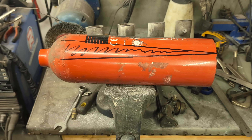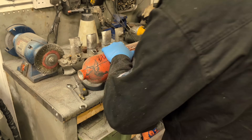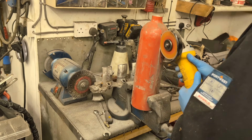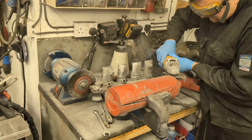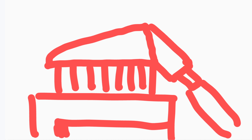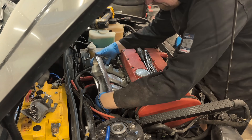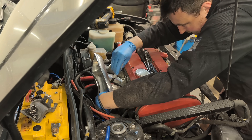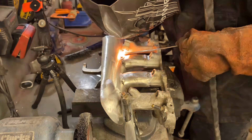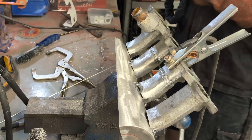I want to give a big shout out to my friend Connor who helped me design this inlet manifold. He has a background in flow testing and motorsport engineering, so we put our heads together and carefully planned the exact size and shape for even cylinder air distribution, and also looked into plenum volume for maximum peak horsepower. Jokes aside, he did give some decent advice - we've deliberately tapered the manifold so it doesn't force all the air into cylinder 4, which is a common issue with big plenums. Once it's mapped I'll keep an eye on the spark plugs to confirm airflow distribution.